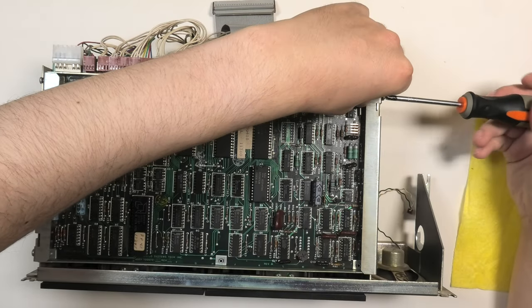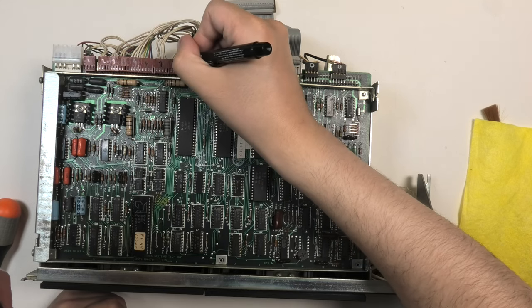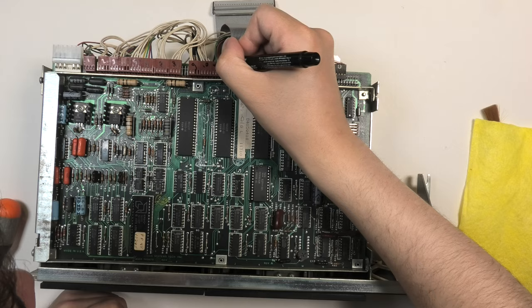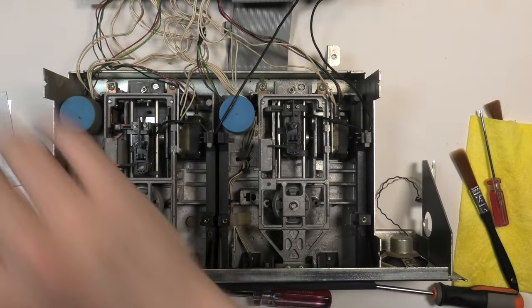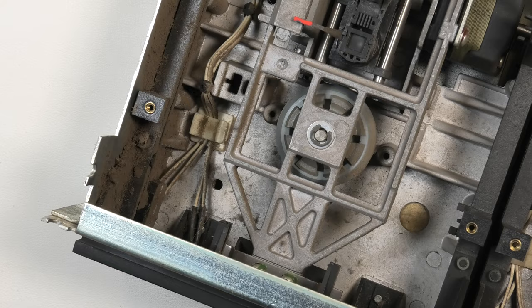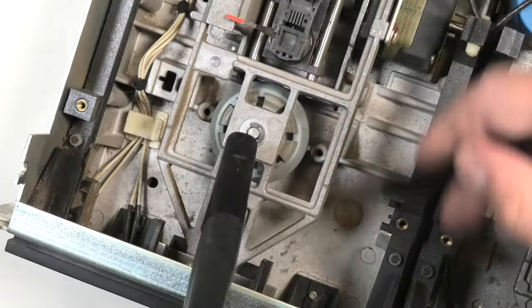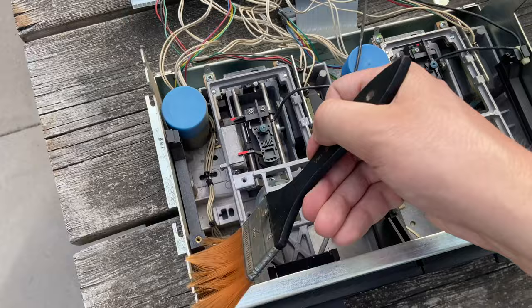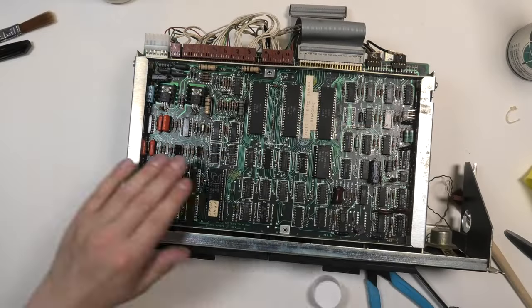The disc drive part — I found those connectors daunting, so fearing I might forget where something goes I decided to number them. I screwed loose the protective covers and found, yes, even more dust. I carefully removed the dust from the drives, lubricated the drive rails, and screwed everything back together. Then my connectors arrived.